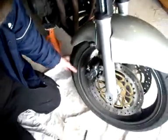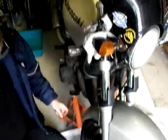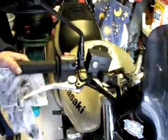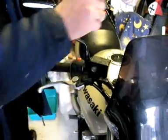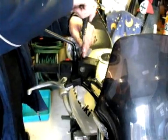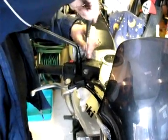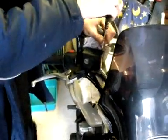That assembly is now ready for putting back together and we're going to bleed the system. We've got all the brakes back on, we've got new pads in, everything's looking good — except we've lost so much fluid and it'll have a ton of air in, so we're going to bleed air out of the system. If I take the top off the hydraulic reservoir, you'll find underneath there's a piece of plastic and a diaphragm as well, just to keep it from getting air in.